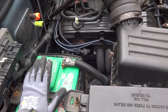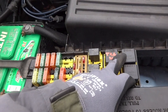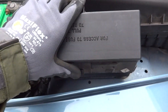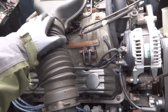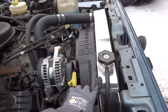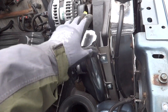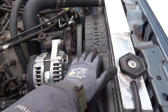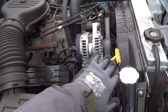This is primarily based off of the TJ harness with a few connectors from the Dodge harness blended in, so most of the Dodge harness went unused. We've got the stock TJ battery and fuse box. I added a few circuits in there — an automatic transmission relay and a fuse for the automatic transmission. Stock TJ air box with the Dodge V8 air hat and hose going to the air box. We've got a V8 conversion aluminum radiator — I think it's American Eagle brand — and a coolant overflow tank, also off eBay, with a bracket I made up mounted to the radiator. We've got the 6-cylinder 4.0 TJ fan shroud with a Ford Explorer fan and the Dodge fan clutch tied into the water pump.